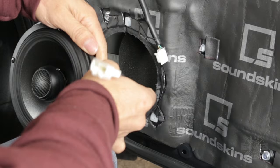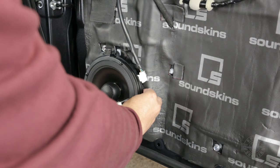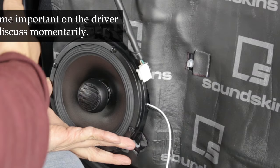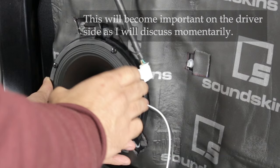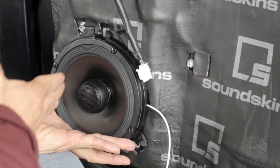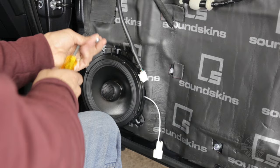The speaker is going to sit just like this. Notice this side is very narrow and this side is pretty wide — that's so the speaker faces more towards the listener and less towards your feet. Make sure you keep that in mind when you install the speaker. Also if you're installing a speaker where you can angle the tweeter, angle it upward towards the listener because high frequencies are very directional unlike low frequencies — you'll definitely hear better if they're pointed toward you. Then you can go ahead and use the same screws that came with your stock speakers.